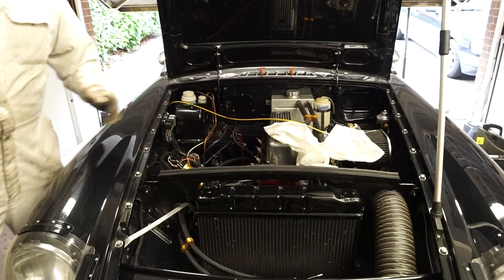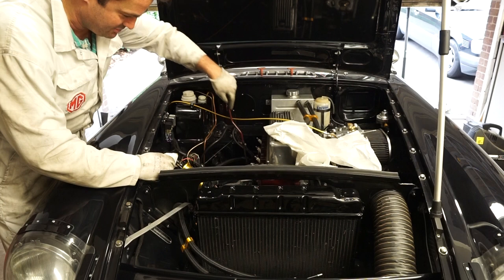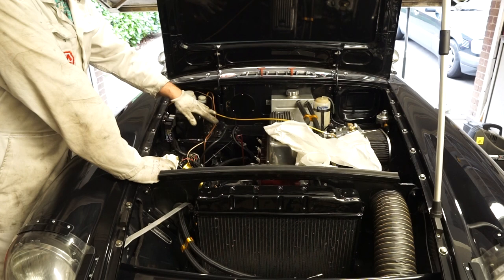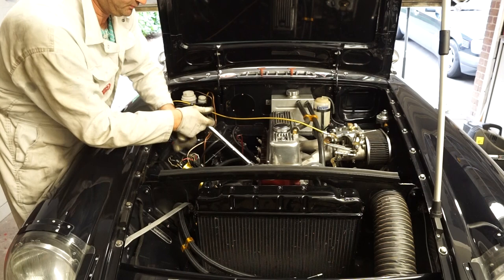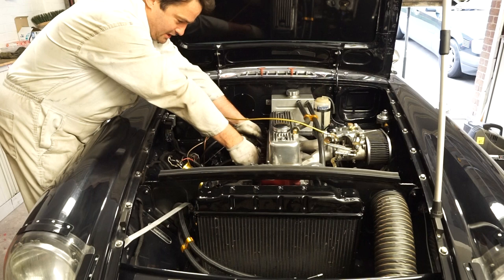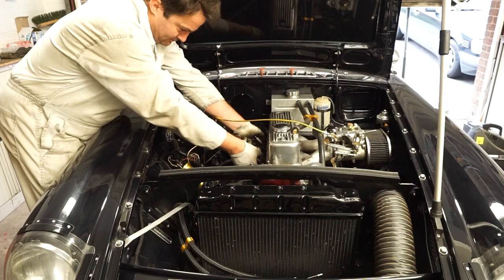The oil has had a little bit of time to work its way down. We're about halfway between the minimum and the maximum on the dipstick — that's sitting pretty good. What I like to do now is spin the engine over without starting it, just to make sure the pump hasn't lost its prime and to make sure we've got good oil pressure. So I'm going to take the spark plugs out, disconnect the fuel pump, and just spin the engine over. This is good practice — especially important if you've left the car over winter.